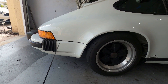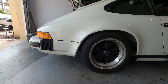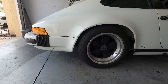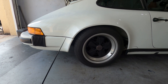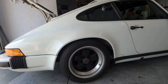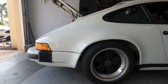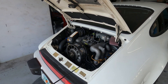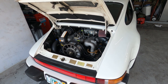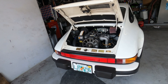Looking at the car from the side, the center of the engine is somewhere in here. It's a single overhead cam, two-valve engine with a wide splay on the valves — one valve cover down here and another valve cover up here, and the camshaft runs somewhere around here. The engine ends around here, so really the meat of the engine, the weight, would be right in this area. Everything from the intake up is relatively light compared to the weight of the crankshaft, rods, and all that.